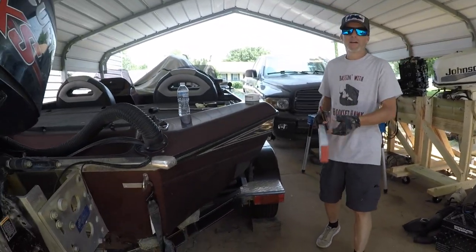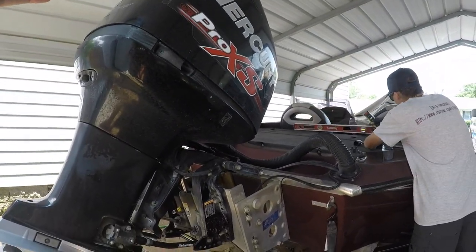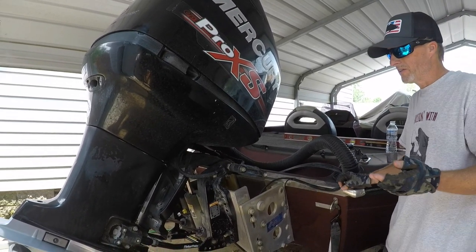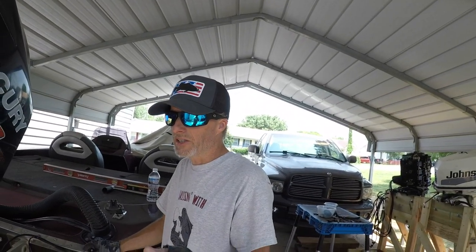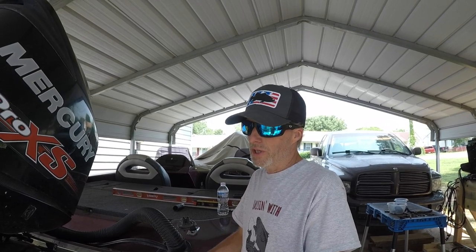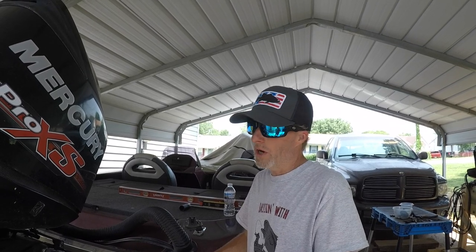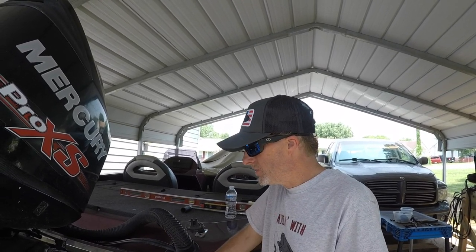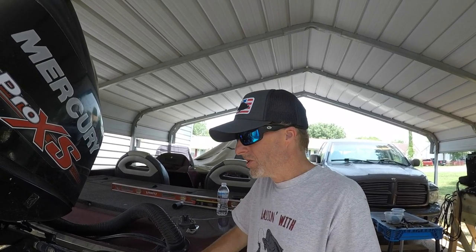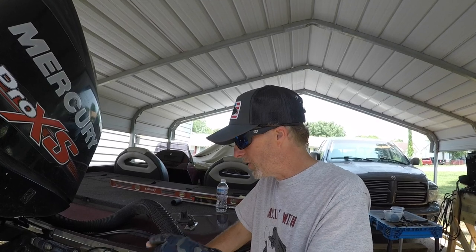Well, in the meantime, I have lifted the motor up with, see, now in Jeff's case, something that I noticed, because he kind of had the same problem with his when he first got his boat, is that he had a 27 pitch prop on here, which I thought was kind of high. Way up there. But it was the same deal. It was doggy out of the hole, and it never had all that top end with that other prop. So I'm wondering if that's the problem here too.